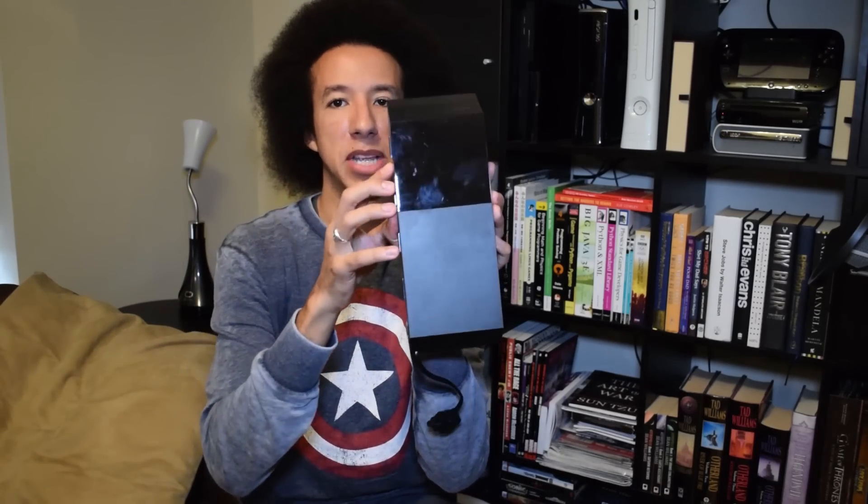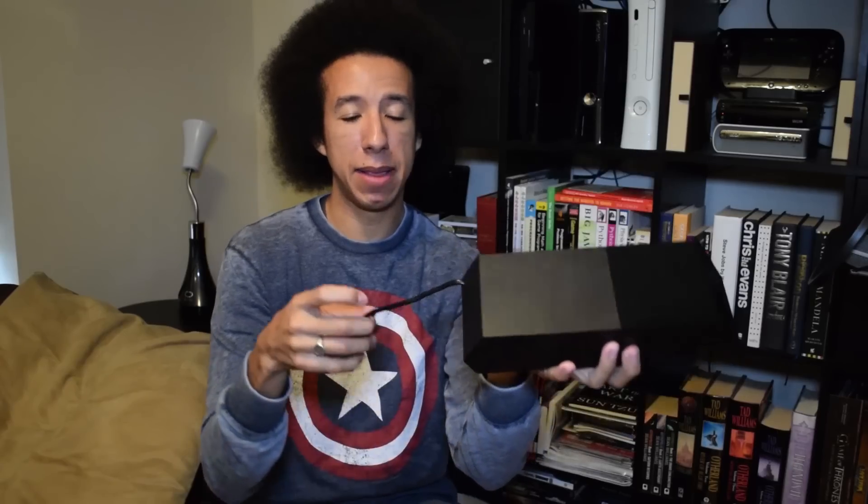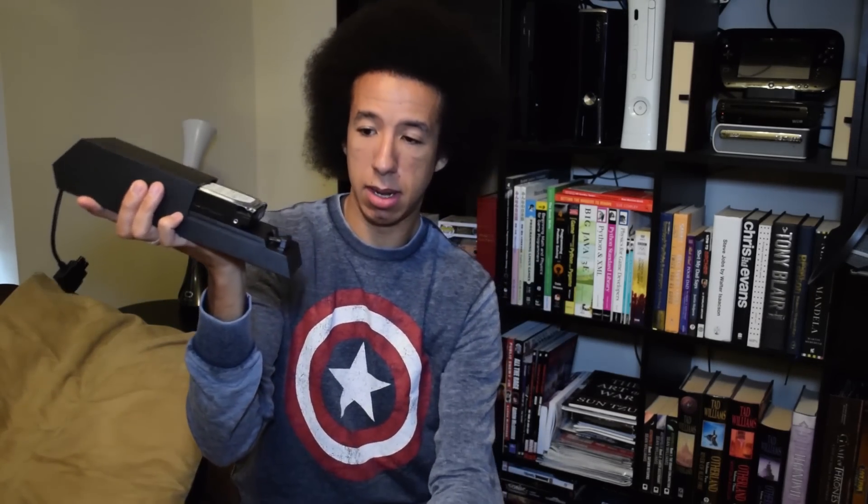In order to use this, I have purchased a special piece of kit called a databank. This right here is from Nyko. What this essentially does is it goes on the side of your PS4 — like this — where the hard drive casing is, and it will plug in the back. It takes power, going into the PS4, and then on the other side where you put the normal power cable. It just enables you to use a regular hard drive. I slot in my hard drive, it clicks in real nice, and then I'm done. The way it connects is it comes with this little adapter — the size of an adapter hard drive — which goes in the PS4 where a hard drive normally would. That clips in there, and then this end will connect to the underside of my databank.